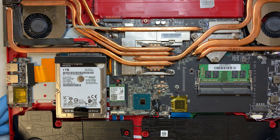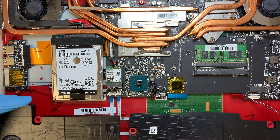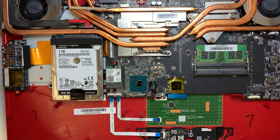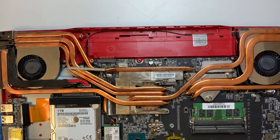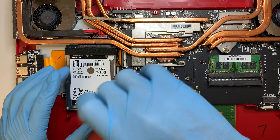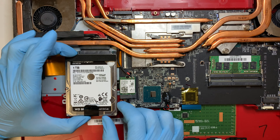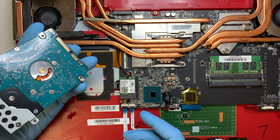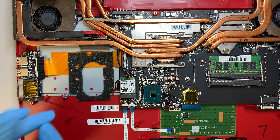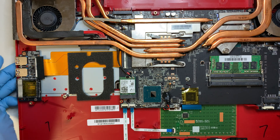At the bottom here is your speaker. I'll remove the speaker first — it's simple, just lift it up and disconnect the speaker cable. The next step is removing the hard drive. There are two screws that hold on to the bracket; once removed you can slide the hard drive out. I believe this hard drive is a secondary drive and not the OS drive — we'll see what's underneath the motherboard when we get to that section.